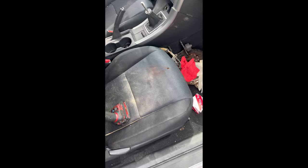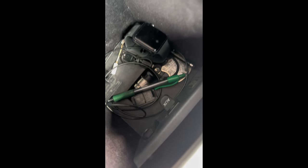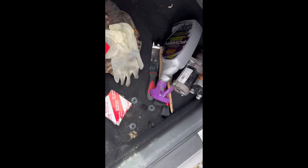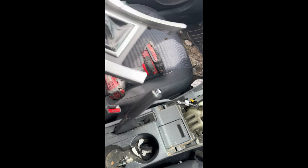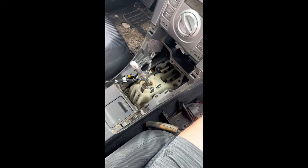It's pretty simple, there's two T10s inside of here. Sorry about the mess - let me clean this car in a minute. There's one T10 right there and there's another one under the pen tray. Then you unscrew the cigarette lighter thing, and obviously this is your shift knob - let me get this all taken off. Also, you take this trim piece off first - I use a little screwdriver to pry it off.